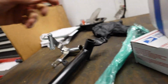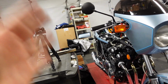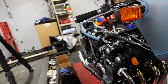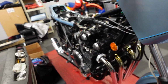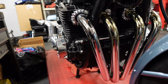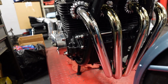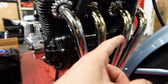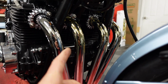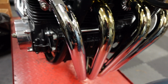With the 2023 motorcycle season, I did start the Z1R, as I showed in that video. It was running like dog shit, so I said, alright, I gotta sync the carbs. That's probably what it is, carb sync. And started it up to warm it up. You want to sync the carbs, you want to get it nice and warm. And unfortunately, noticed that 3 of the pipes have started to yellow because of the heat, and one of them is not. So if you look at them, one of these things is not like the other.